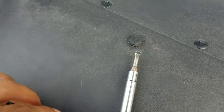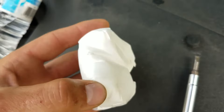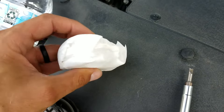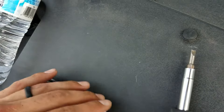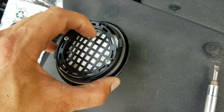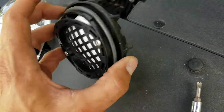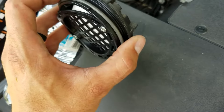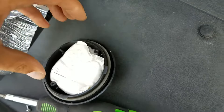They put these big white packets inside the headlight dust cover — I guess to draw moisture out of the headlight if it gets moisture inside. A lot of headlights don't have these and I don't think they're really needed that much unless the headlight is made to leak. I went ahead and took it out of the driver's side and I'm going to take it out of the passenger's side too. All you do is take off these two screws, pull the little black holder piece off, and take the white stuff out. That way you have more clearance for your LED fan — otherwise it might press right up against the fan and prevent it from turning.